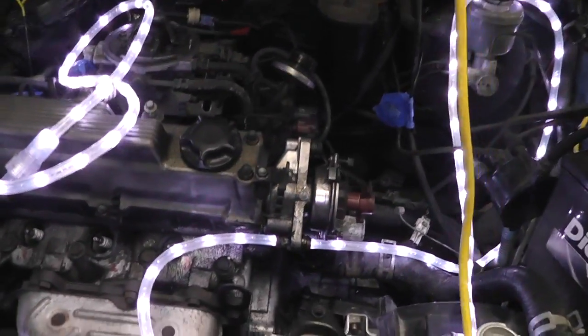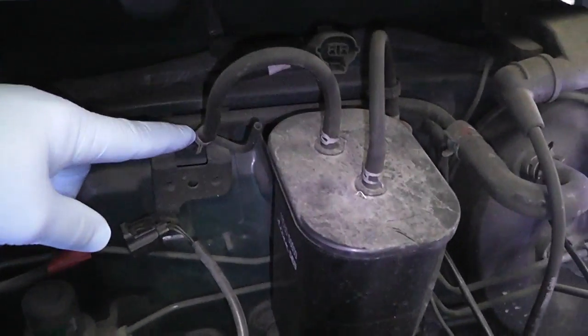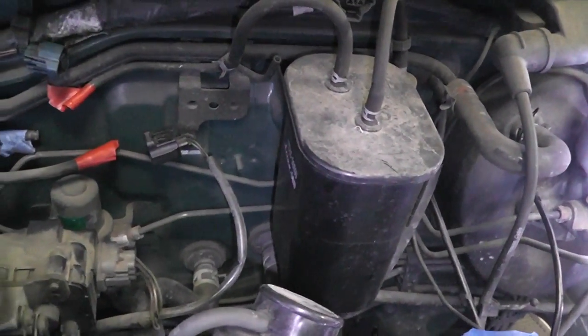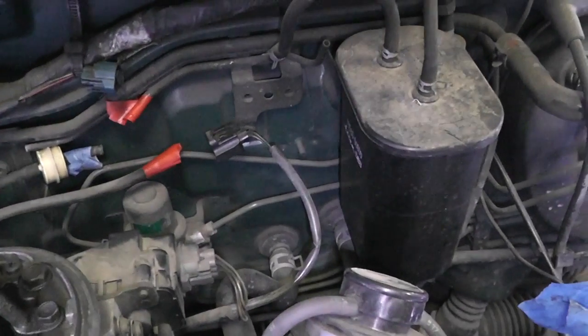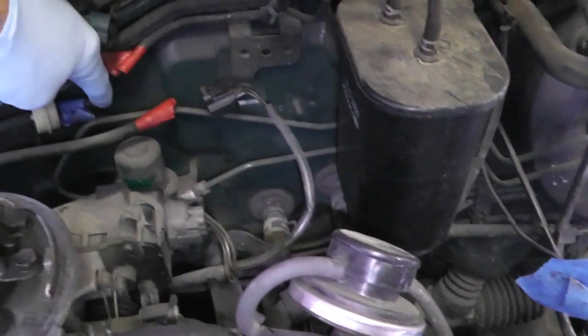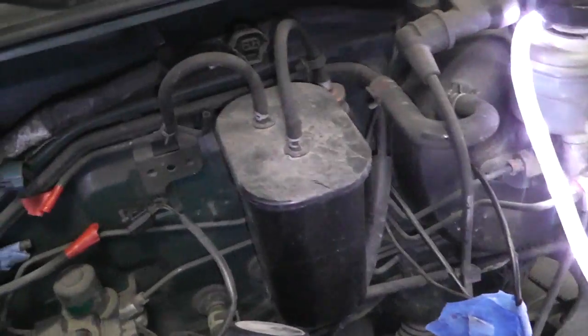It's getting a little too tedious to try to do each one on video. With the vacuum hoses, what I found after breaking a couple loose — some of them have hose clamp deals where you just pinch them and they come off. Others attach to little nipples. Don't just pull on it straight because that adds tension and tightens it — I snapped a couple that way. If you twist it first, a lot of times they'd come right off. Or grab a screwdriver, stick it on the end and twist it to push it off without creating extra tension.